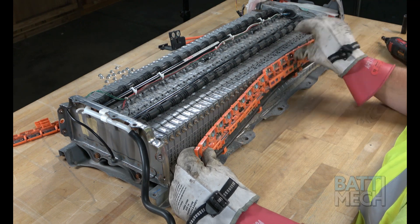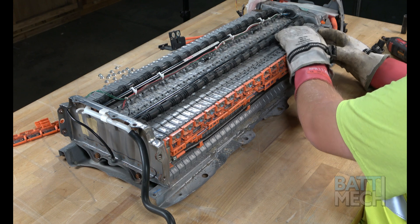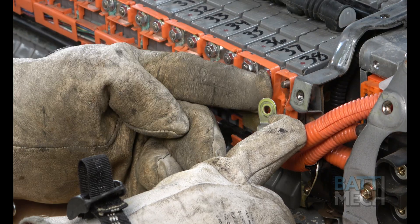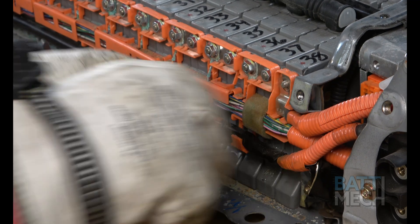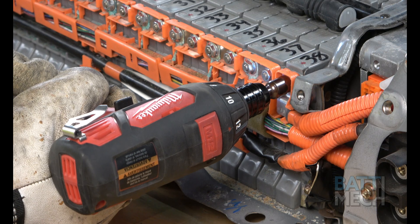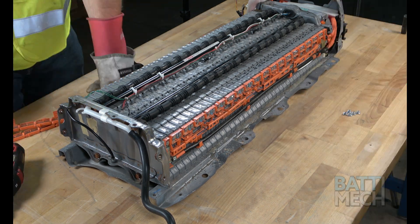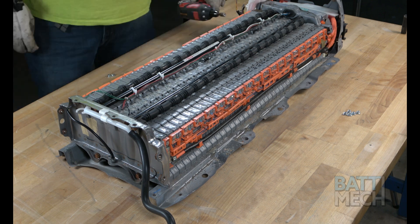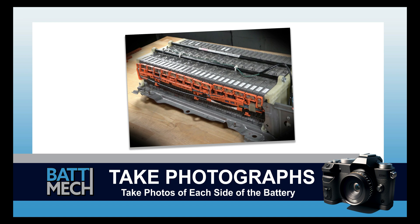Now that the bus bars are replaced and you have your torque settings figured out, go ahead and attach the wiring harness to the battery module terminals using the new BATMEC supplied nuts. One thing to keep in mind before securing the orange wiring harness is that the main wire at the end on this side can easily become dislodged — make sure it is inserted into the wiring harness over top of the bus bar. Go ahead and replace the wiring harness on the opposite side as well using the BATMEC supplied nuts. Now's a good time to take a photograph of each side of the battery; these photographs can be used for review of assembly if you experience issues and may save you from having to uninstall the entire battery later.